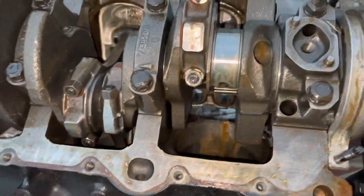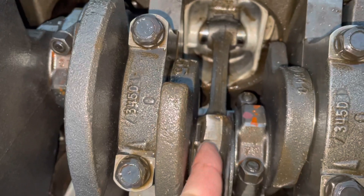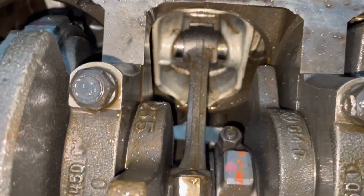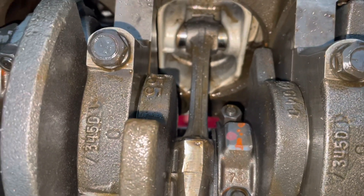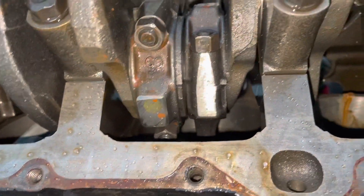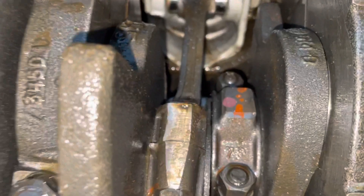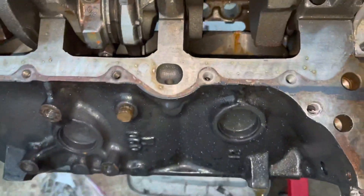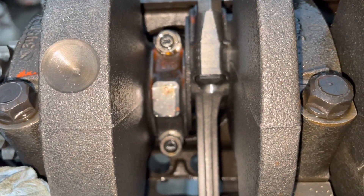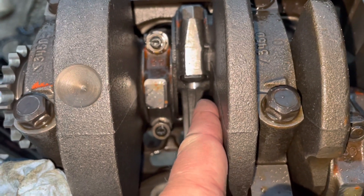Each rod on the V6s has an offset. You can see right down through there — the rod does not come into the center of the cap, it's offset. Looking at this in the video, it's offset to the right, so the fat part is to the left and the narrow part is to the right. On this one, the narrow part is facing forward; on this part, the narrow part is facing towards the center. So it looks like on every rod, the fat part of the offset is away from the center of the crank pin — if you call the split the center, your fat part of the offset is away from it.